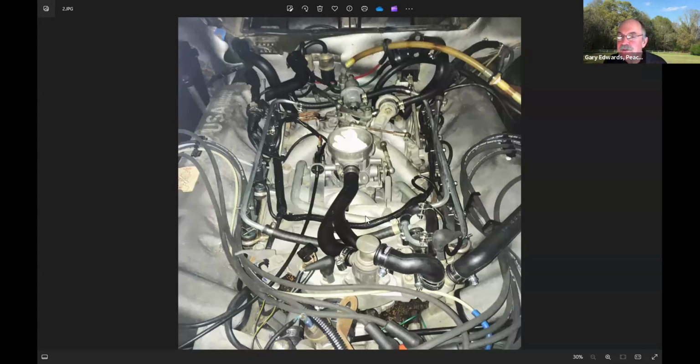But some of the things I learned from doing this intake manifold are you have to be really, really careful on a couple of the pieces that can fall into the wrong position when the manifold's out. There's this linkage that goes down to the transmission on this side, and behind here, there's a vertical link that comes up to the throttle. And I had a really hard time because I wasn't diligent about making sure that they stayed up while the manifold was out. It would probably be best to just tie them up. I did not do that. And I ended up putting the manifold back on, and I went through some awful machinations to get the transmission piece back on. And I found out I could not get the throttle piece back on because it was sitting in the down position, and it rotates to go all the way back up.